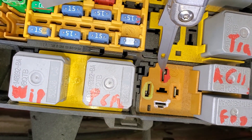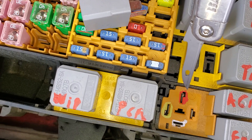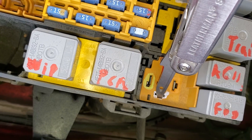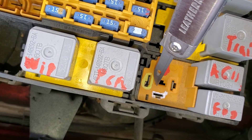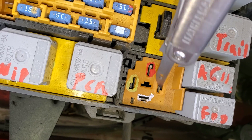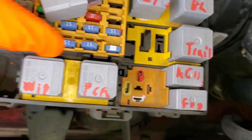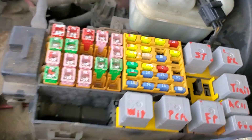Let's discuss the pins for the fuel pump relay. This pin marked in red carries power from that 30-amp fuse. When the fuel pump relay is energized, it takes this power and sends it to this pin, which goes to your inertia switch — a safety device that cuts power if your car is in an accident. The relay is controlled by two other pins: one should measure a constant ground, and the other receives power from that 2-amp fuse inside the car whenever the key is in the on position. When engaged, it sends power to the injector fuse and also to the inertia safety switch.